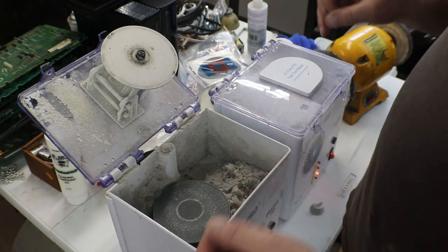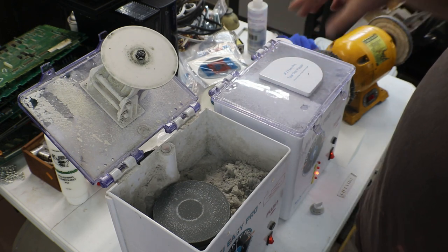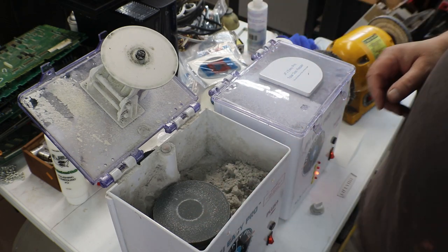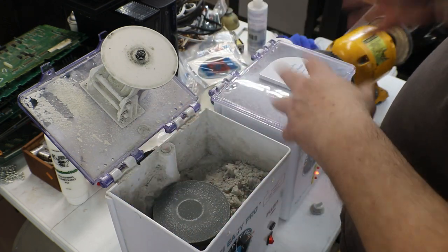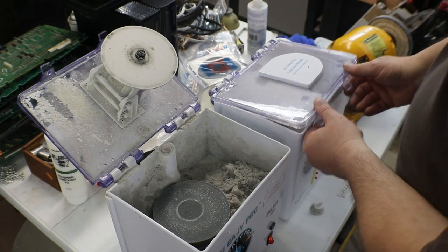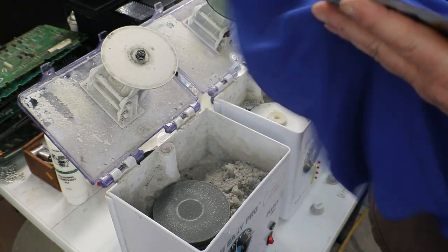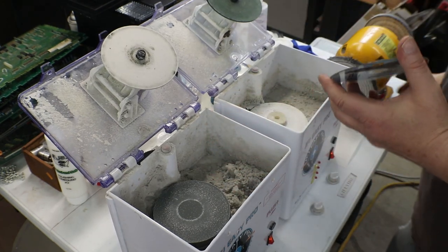And I've had it to where I've had my machine so hot it was melting the lacquer on the discs. That's how hot I got that motor, or the pad, from the friction. That's when I have a ton of them to do. But now, I'm not doing quite as many, so I can just take my time and sand and move down and make sure my machine stays cool. I've had it to where you couldn't even touch my buffer. It was so hot. And the buffer doesn't really take material off per se. It'll flow the material into cracks and crevices.